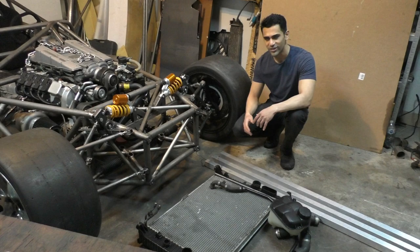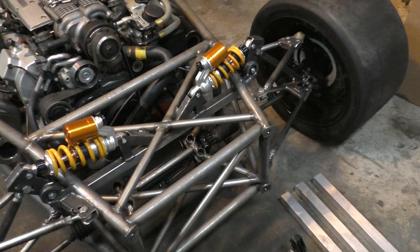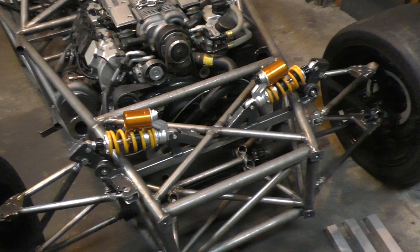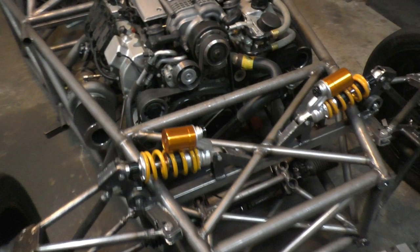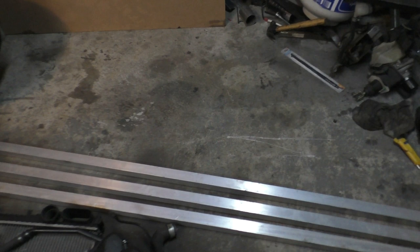Let's get started by making the crumple zone. First, a quick overview of changes since the previous video: I've finished all the remaining welding on the front end and added all the cross members, triangulating everything. The triangulation isn't perfect — these tubes should be meeting at one point but they're meeting elsewhere because of obstructions like the coilovers. That's why I left triangulation to the end. What's left for the front end structure is adding the crumple zone, then four more bolting points and some finishing up between the chassis and engine, and that will be the whole front end structure complete.